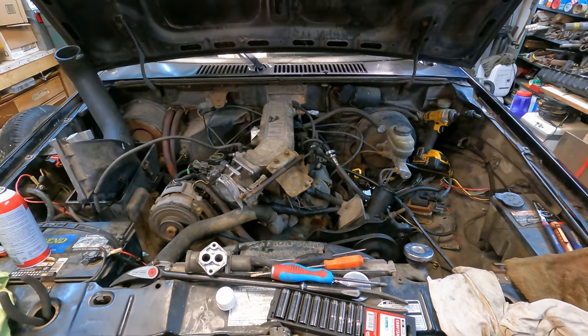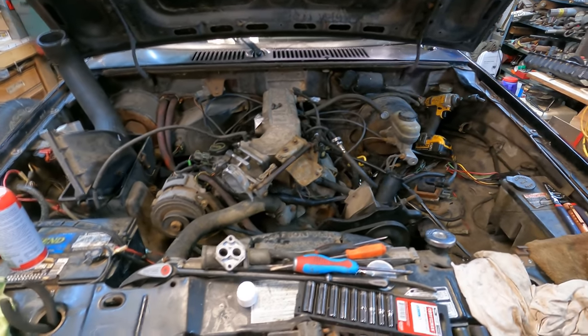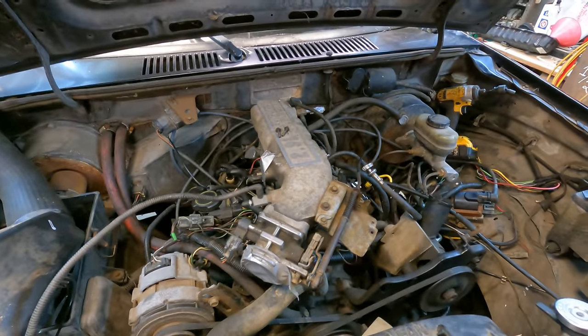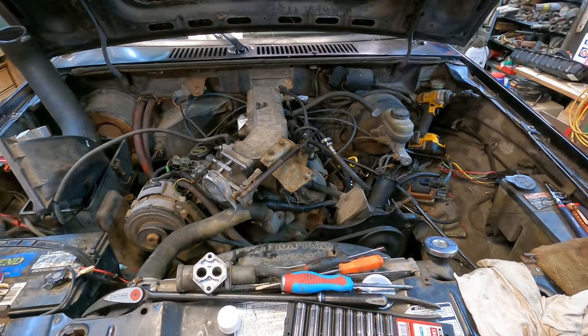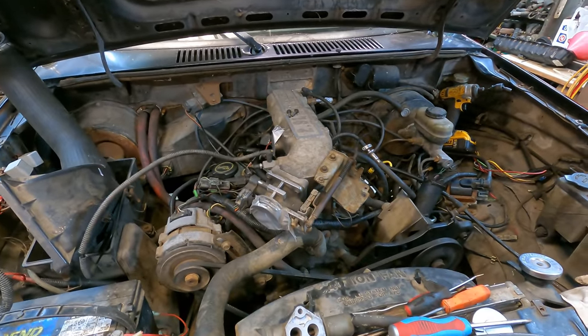But anyway, so where we picked up last time, I had it running. It wasn't running super smooth and it was idling very high, right around 1800 RPM actually. So I could not get the idle to drop down. So I started naturally looking for vacuum leaks,